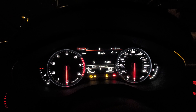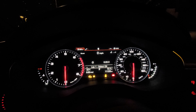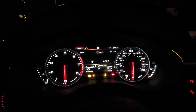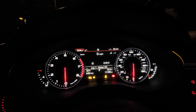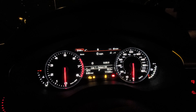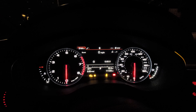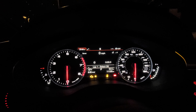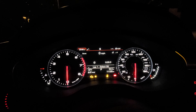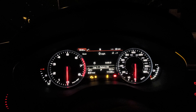As you can see, on the top left it says Boost — that's your boost pressure for those who have turbo cars. It still shows your digital speedometer in the middle. At the top right you can see your oil temperature gauge. A word of warning: it's not going to give you any number until it reaches operating temperature, which I think is around 145 to 150 degrees Fahrenheit. That blank black space between your options on the bottom and the digital speedometer readout — that's where your tach shift points will appear as green bars and then eventually red bars when it's time to shift, but those won't come up until you get to a certain RPM range.